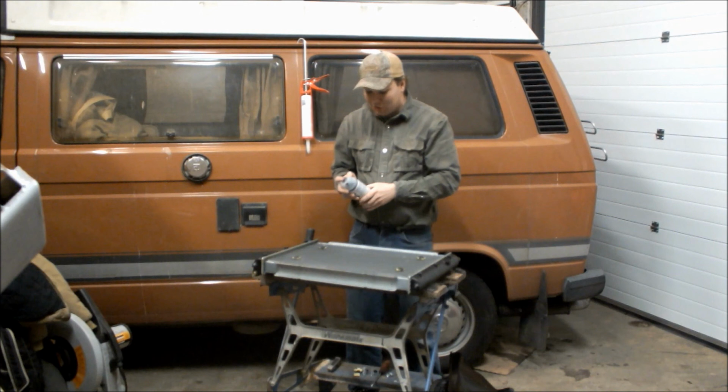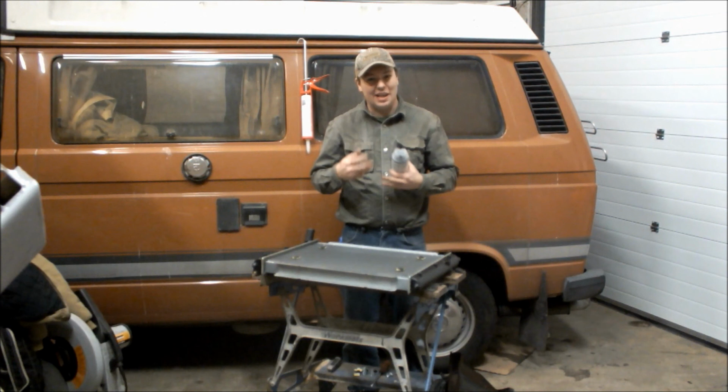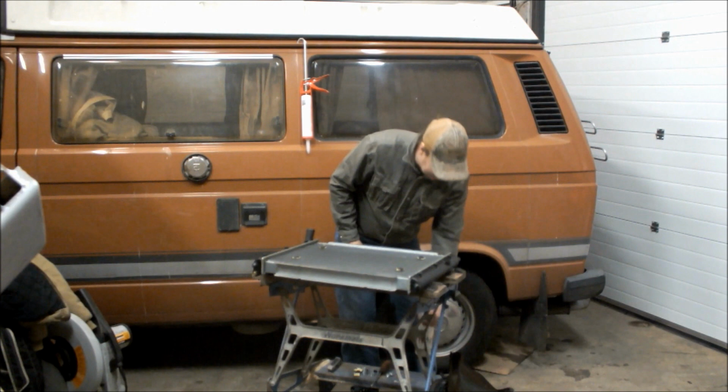And absolutely hammer the radiator with it, as much on as you can get on. All that's going to do is it stops the water when it sits in there making the aluminium go all fustery and horrible. I put it into my Jeep probably 3-4 years ago, and the radiator still looks like the day I fitted it. It doesn't overheat, there's no adverse effects to doing it, it just makes everything last a bit longer. I suppose you could use paint really, but I've found that works well, so that's what I do. Right, cowling.